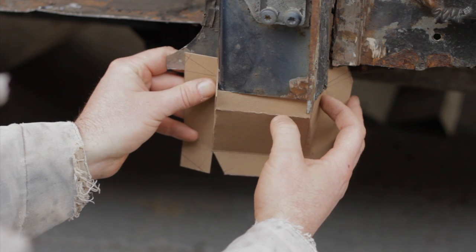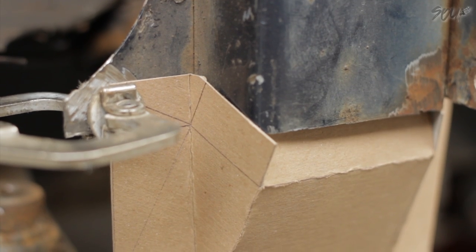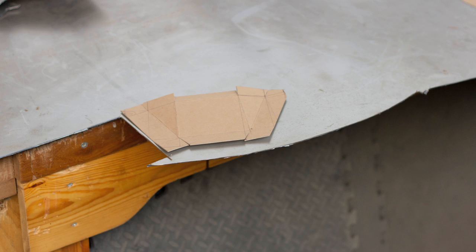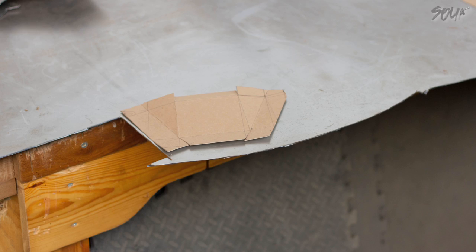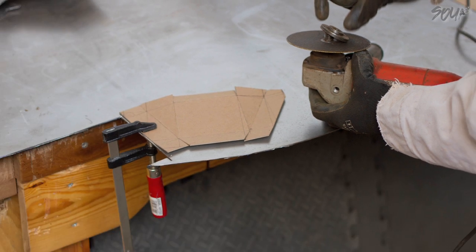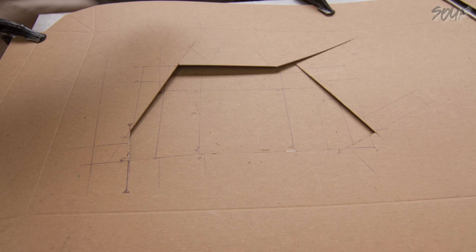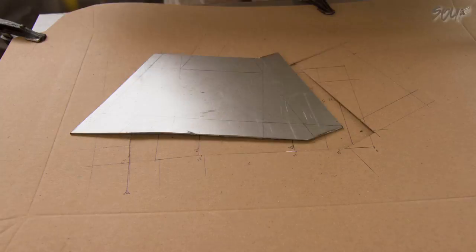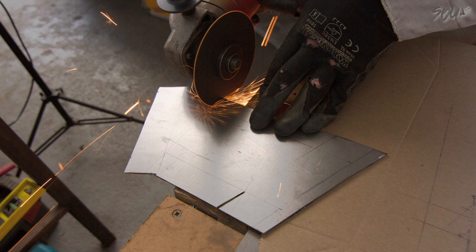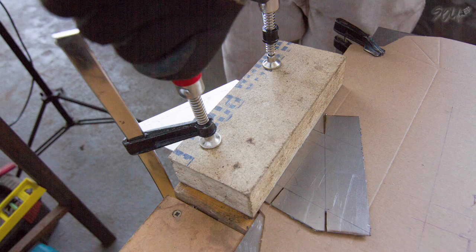Back on to offer-up and it looked good. Now obviously the radii aren't in this for the bends, but they will come just by bending the metal itself. This was looking great. Over to the sheet metal to transfer this shape and then cut it out. Now watch out, kids — I have the guard taken off this grinder. This will not forgive you even the slightest brush, so if you do this, you do it at your own risk. Transfer the shape to the piece of metal and then I bent this by hand using a block of wood and the edge of the bench and some clamps, which is a more versatile way than even putting it in a vise.